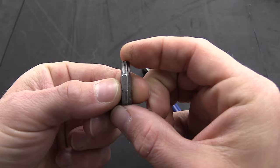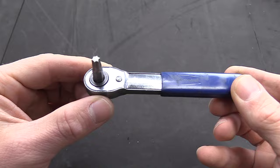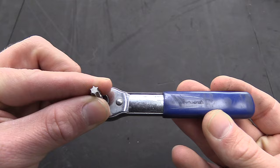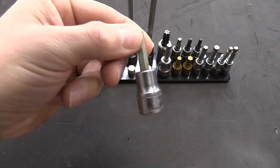If you're doing things like intake manifolds, the longer Torx bits work amazing. It's also not a bad idea to have an extremely short set of bits for those really tight spaces, especially on the interior and underneath the intake manifold. This bit driver is made by Bluepoint — it's extremely fine tooth and works great for things like the IMRCs on the FSI engines, and for ABS modules and the HVAC motors on B5 Passats. There are other versions that are not fine tooth; I do not recommend those. Get the fine tooth ones — they're a little more expensive and worth every penny.